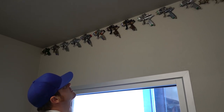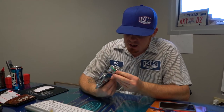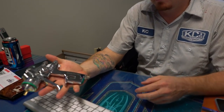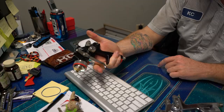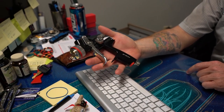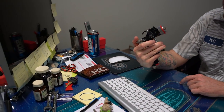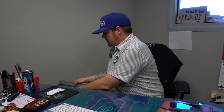The camo guns were my go-to on the show, and then the 5000s came out so I swapped over. Here's another 3000 with a 1.5 tip — that's the one I used for flake jobs. This is my polyester gun, I just had it rebuilt. I've got two of them because if you spray polyester, that stuff sticks and they never get truly clean. Two is one, one is none.